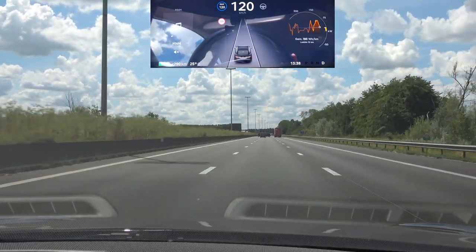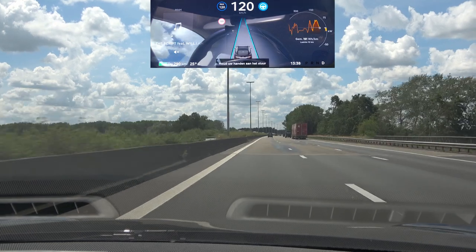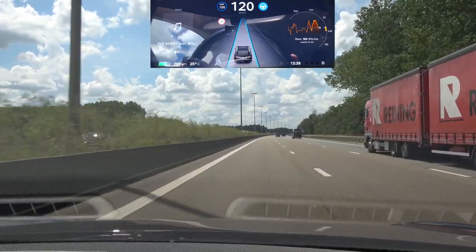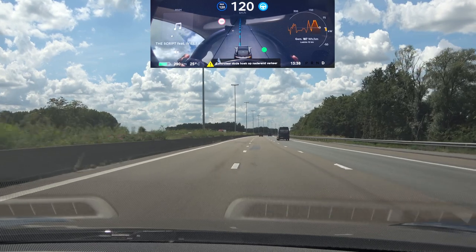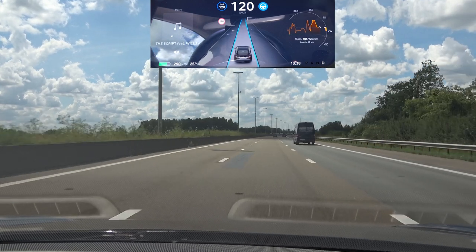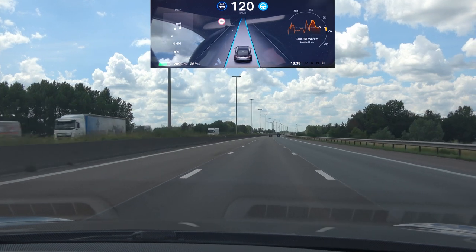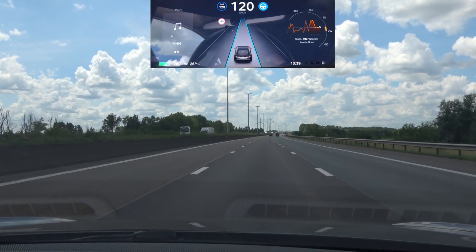We don't have navigate on autopilot on this AP1 car, but I can test how it reacts to that truck in the first lane while I'm in the third lane. To move over, I need to lock the blinker. Next to the truck, locking the blinker — it's going, it's going — yep! That seems to be a lot better. That confirms to me that the side cameras are the ones acting up in AP2, which is logical. AP1 only has ultrasonics to work with, so that's actually an advantage.